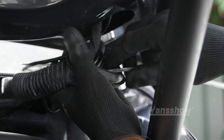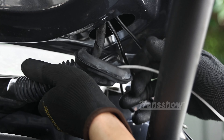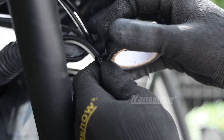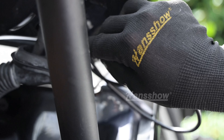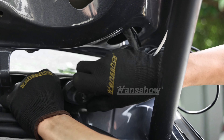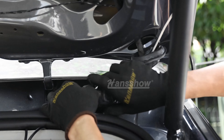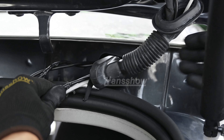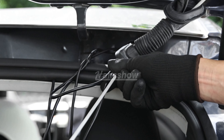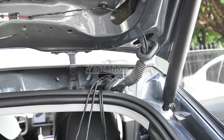This is the conduit from the right hand side of the Tesla Model Y. You want to open up between the lift gate and the vehicle, then run the fish wire through from the top to the bottom. From the bottom you will be fishing it through inside the vehicle roof, which will allow you to fish it from the back of the corner tail light to the center of the actual lift gate or tailgate. Be patient with this, use gloves if you can, and be gentle when pulling through — you don't want to yank or cut any wires inside that conduit. Fish this wire through the conduit from the inner tailgate to the outer corner tail lights that you just installed.